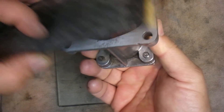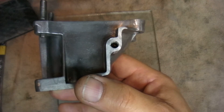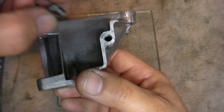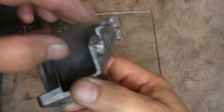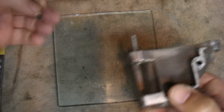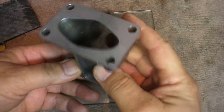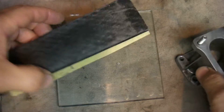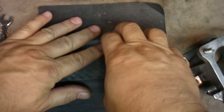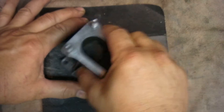My manifolds are pretty bad, so this is the one I just took off my car. I took a plug out of it because I'm having some trouble with air leaks - I don't know if it's from the carburetor throttle shafts or this little plug that was put in by someone else. It's a little metric bolt. Here's a glass plate that's good for lapping parts like this - take a nice new piece of sandpaper, put a few drops of WD-40 on it.